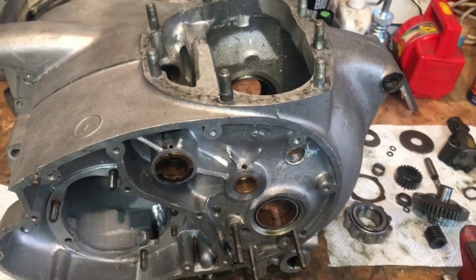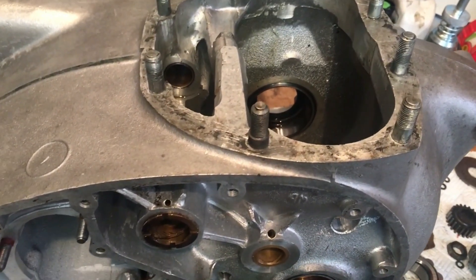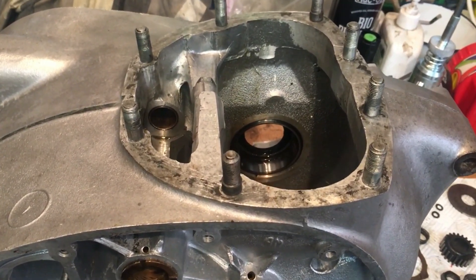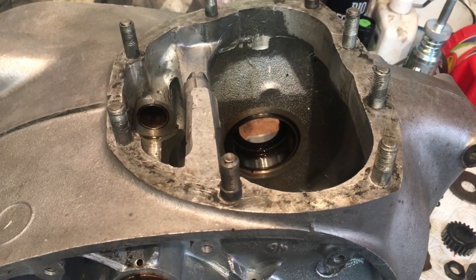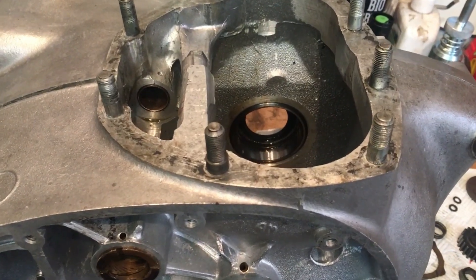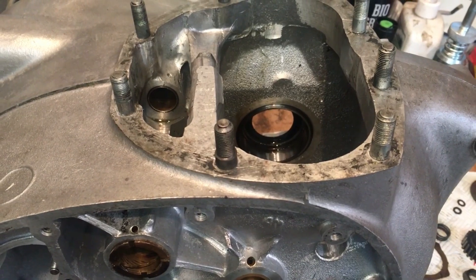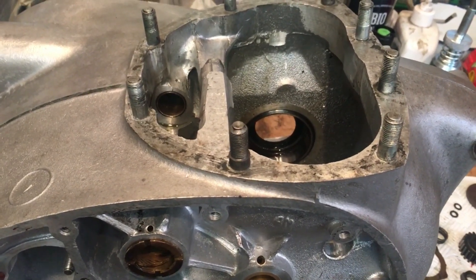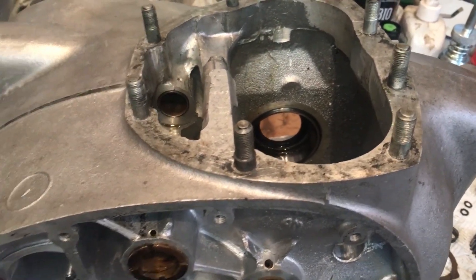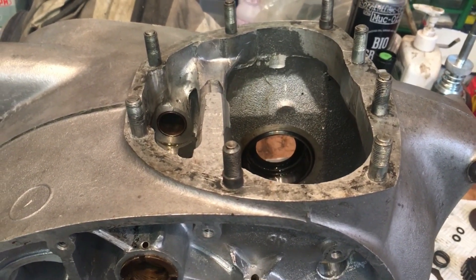So what I've done here is bolt the cases together with nothing in, all tightened up with all bolts and nuts, so it's lined up how we'd expect it to be when it's in the bike. And all I'm going to do really is probably use this reamer by hand just to see how we get on with cleaning that bush out, how difficult it is, and we might have to get some tools out if there's a lot of metal to take off, but I wouldn't have thought so.